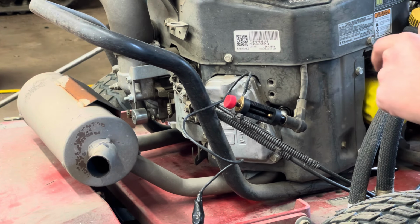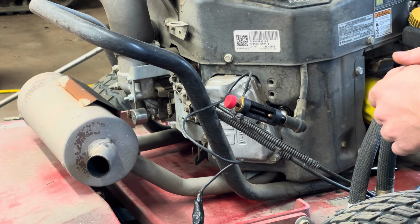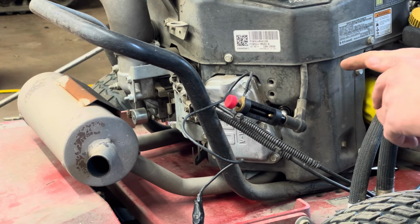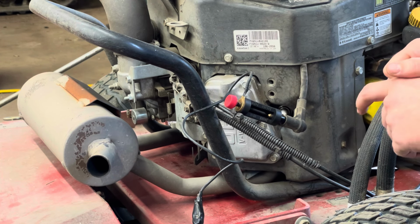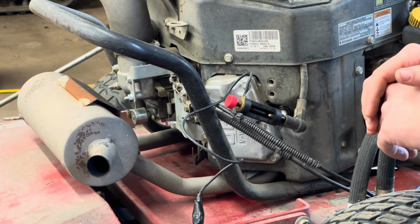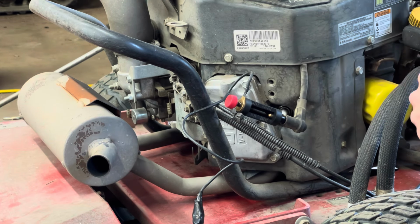All right, so there's a couple other things that we do need to check, mainly the air gap that sits against the flywheel and the ignition coil, okay? But at this point, if you were at home, I would go online, order 2 new ignition coils and 2 new spark plugs. You don't want to just put an ignition coil in there, because if it's a bad spark plug causing that ignition coil a lot of stress to be able to jump that, because it's making it jump that gap if there is an excessive gap or the spark plug's loose, whatever.